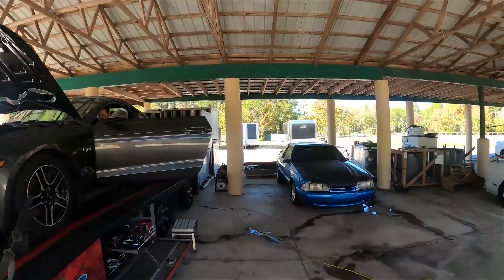Welcome back to the VMP Performance YouTube channel. I'm standing in front of our 2018 Mustang GT with our new Odin supercharger on it. Joe is in the driver's seat about to make a pull. The car is still a stock bottom end, stock fuel system, 2018 10-speed automatic, with just 93 Boostane in the tank. We want to see what Odin will do with a moderately sized pulley, some 93 pump gas, and a good tune.